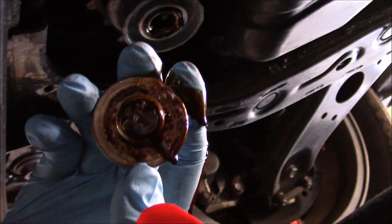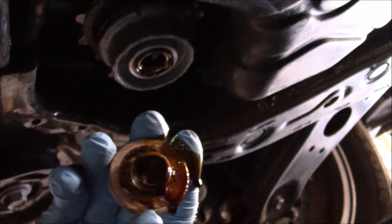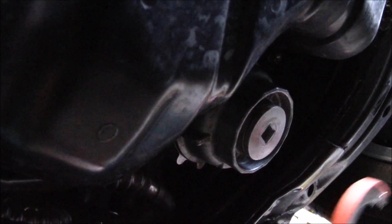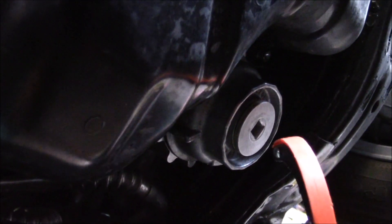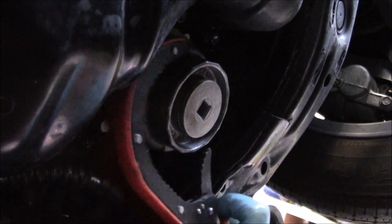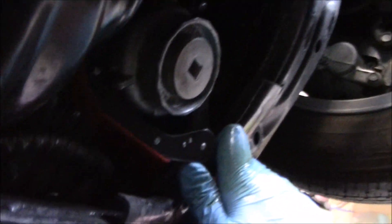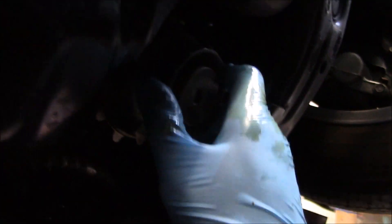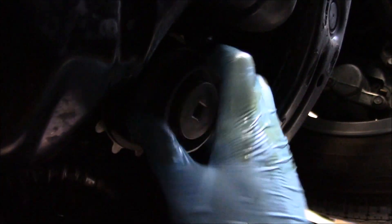There isn't a lot. See this magnet — you have to clean the magnet. You also need to replace the o-ring right there, then unscrew the whole thing. Since I didn't have the special tool to remove the oil filter, I just put this universal oil filter wrench around it and got it off. It didn't take a lot of work.